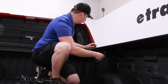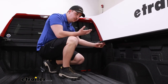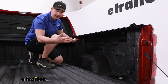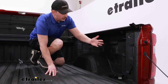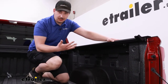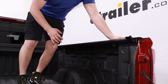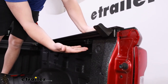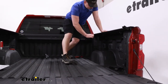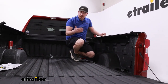Repeat that for the front and back clamps. With all clamps in place, the front and rear clamps go as far forward and back as they can. Once the middle clamp is in, put one hand on the bed rail — you're not trying to hold it up — and apply downward pressure with one hand on the end of the side rail while you tighten. I went back to the middle clamp, loosened it, applied that same downward pressure while tightening, and could actually see the weather strip on the outside flatten out, resulting in a tighter seal.